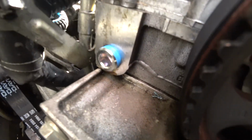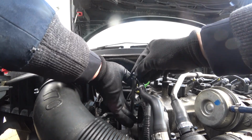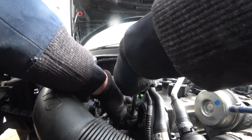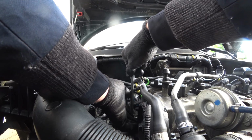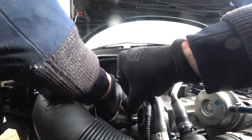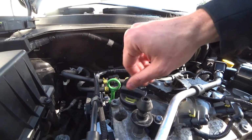So you have to press it in first, and then you can start turning it in. Okay, the torque spec for that is 27 Newton meters, which is about 250 inch-pounds, I think. Just go ahead and Google it, please, because I'm not sure, and I don't have a socket that looks like this, so I'm not able to torque it to the right spec. So please do that. Don't overturn it. It should make a nice, smooth surface together with the cylinder head. Perfect.